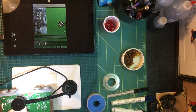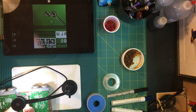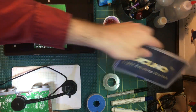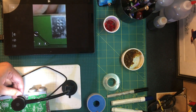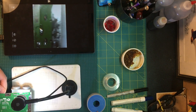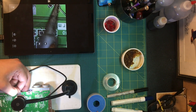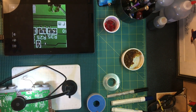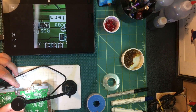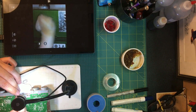Let's get rid of this nasty flux — really nasty. I use SIP headers — single inline pin headers — and sometimes the LEDs fit kind of loosely into them, but I have a way to deal with that. I'll hold it by the LED so I don't burn my fingers and don't have it falling out while I solder. It really has to be a new LED, or else the heat would melt the solder on the LED legs and it would get stuck inside the socket. I use sockets because people change their minds all the time, or they want to see multiple colors — I'll send them multiple colors and let them choose. It just ends up being easier.